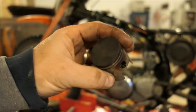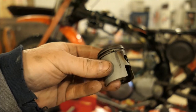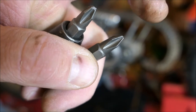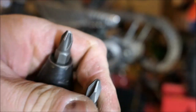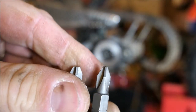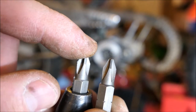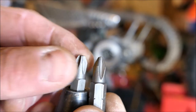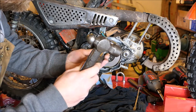Our piston looks pretty good. I need to inspect it a little better and make sure. I was able to find some bits, but they were number two. So to make them number three, I just ground the tip down. Can you see the difference? One's sharp and pointy, one's flat — and this one will fit perfectly into those screw holes until I can order number threes. It fits real tight. I have no doubt it will work.